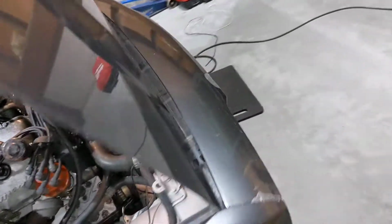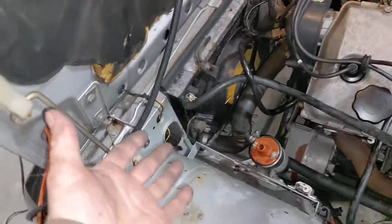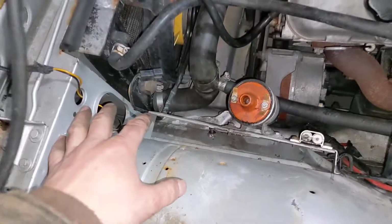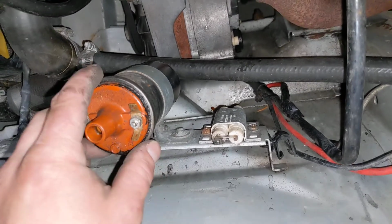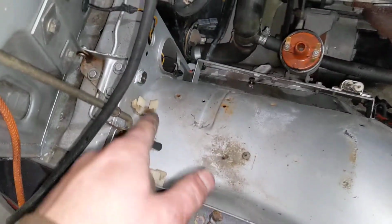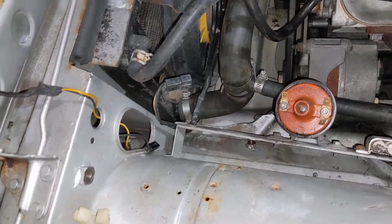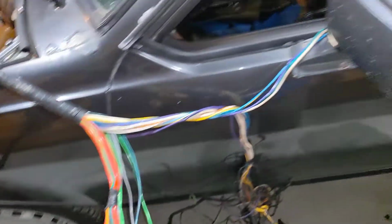So you're asking, what the hell am I doing? Oh yes, I've got a whole bunch of the old wiring as well as the ignition system taken out, just temporarily. And you can see, moving onto this side of the car, there's nothing here. I've got the washer fluid tank out. I've got all of the electronics and bits that go into the front here. You've got the coil ballast, the coil still left there, the ignition unit mounted there, and then this large wiring harness from inside the car would have normally come down here, and then there was just a jumble of stuff all over the place in here, then some other feeders that went to senders and fans and stuff. So I've got that all disconnected, as well as the high current leads from the alternator. And then we have a big pile of electrical tape, which means, oh yes, I have now filleted this GTV6 wiring harness completely.